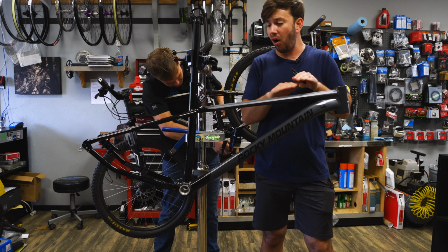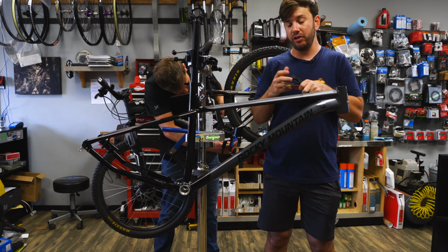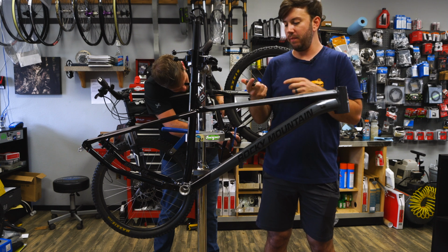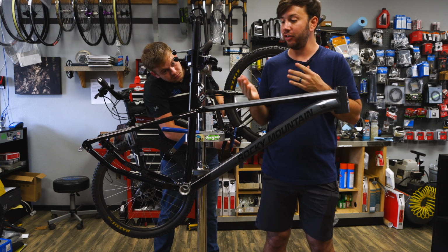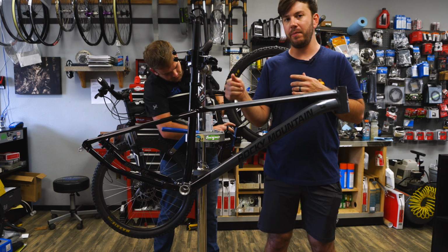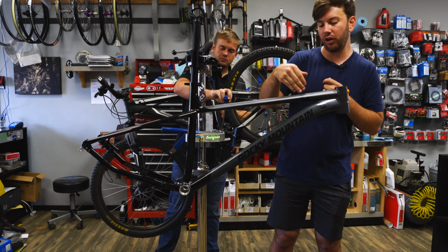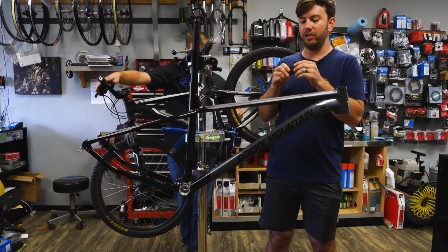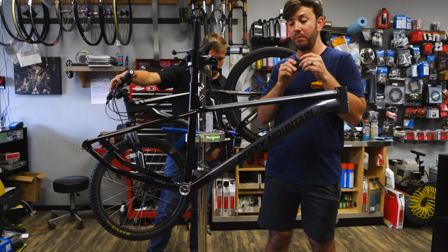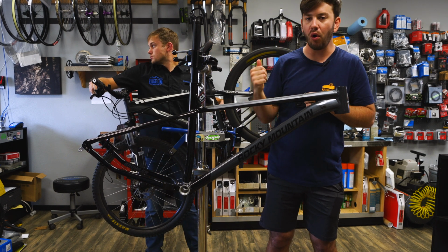So now as you got the top all nice and sealed, all you got to do is roll that edge. Now you can do that with the bash guard or whatever plastic applicator you're using, but I actually like to use my thumbs on this because I like to do it piece by piece, so I just make sure I'm getting all the air out. Because a lot of times on the curves, that's where you can get those bubbles because you push too far or whatever, and you end up trapping some air in there. So I like to just use my thumb to kind of roll the edges.